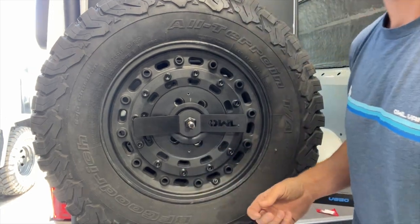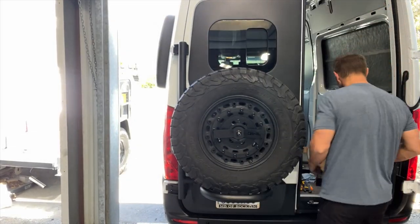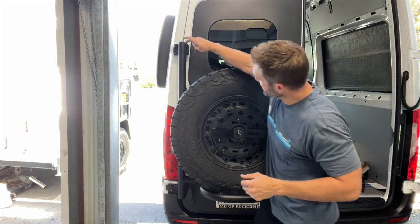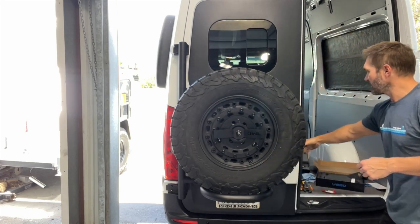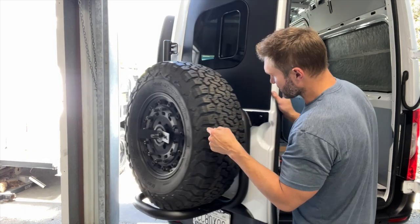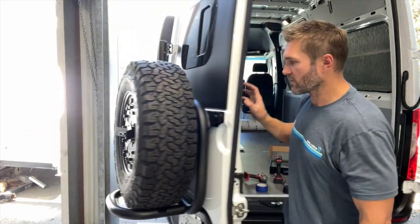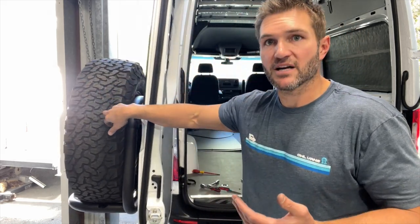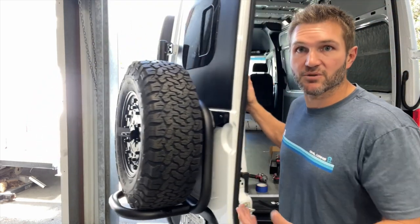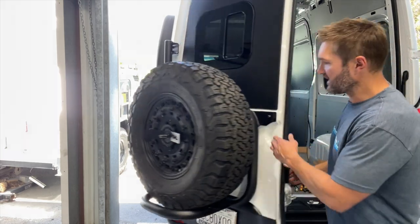That hole there is where the padlock goes. Let's go back through the final checklist: all hinge bolts tight — that's a maintenance item, check every few months or after off-road excursions; the third mounting point tightened; it's been painted; the inner cap is on; the center all-thread is on; the handle is on and level; the cone washer is on. The tabs are totally out of the way and the door still moves nicely. Note that your door now has probably an 80 or 90 pound tire on it in addition to the carrier. Don't throw the door shut like an empty door — I call it closing purposely. Put your hand behind it and let it close gently. Just be kind to your stuff.